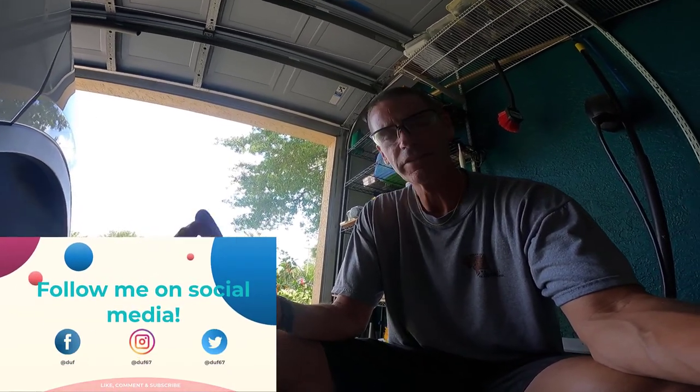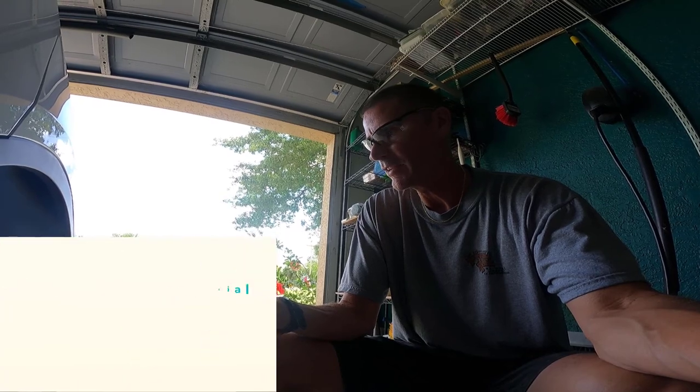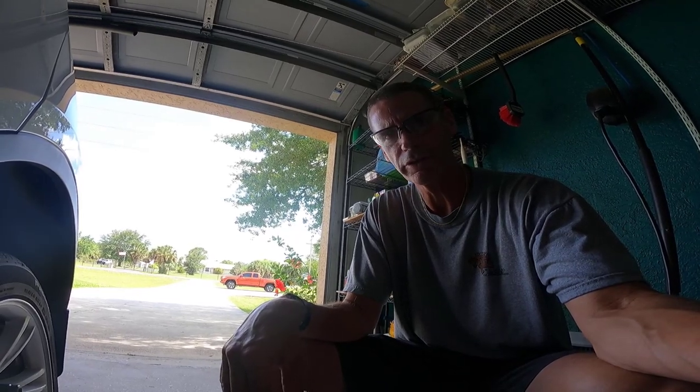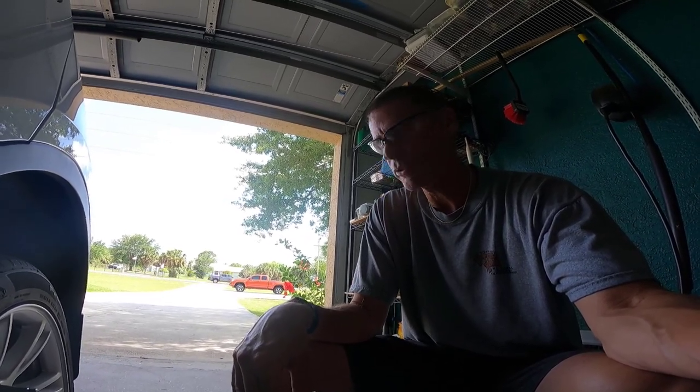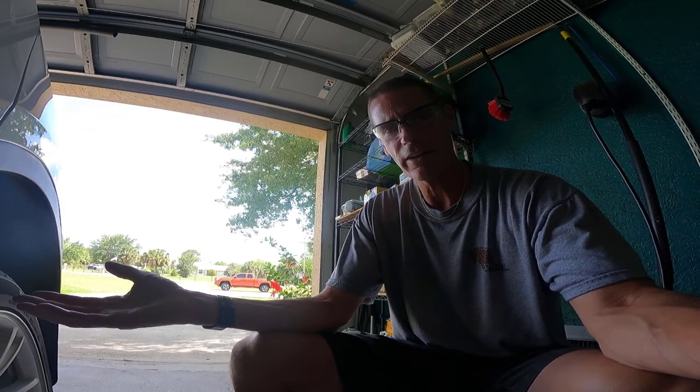The whole reason I decided to plug it last time was because I took it to Costco, who had patched a tire for me before on my Model 3, and asked if they could patch this one. They said no — they don't repair Tesla tires anymore. They're too problematic. These tires have a layer of foam inside — sound-deadening foam — and I guess that causes complications when doing a conventional patch.